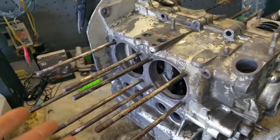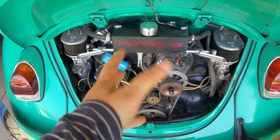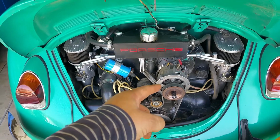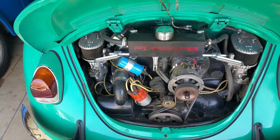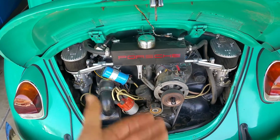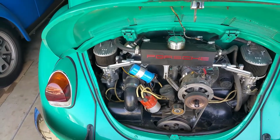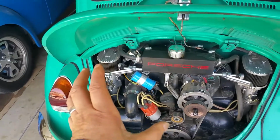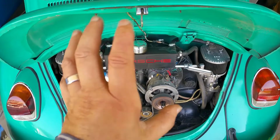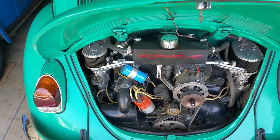See, I was penny pinching because the Porsche engine was going to get taken apart, high flow heads, and I was going to take the engine block to get the registers for the cylinders open to 103 millimeters. This is going to be a 2.4 liter engine with a big cam, a 86A, which requires dual springs. Anyways, that was the whole idea. But now there goes my budget. She's gone. So we're still going to keep saving for this transformation from stock to monster Type 4 engine.